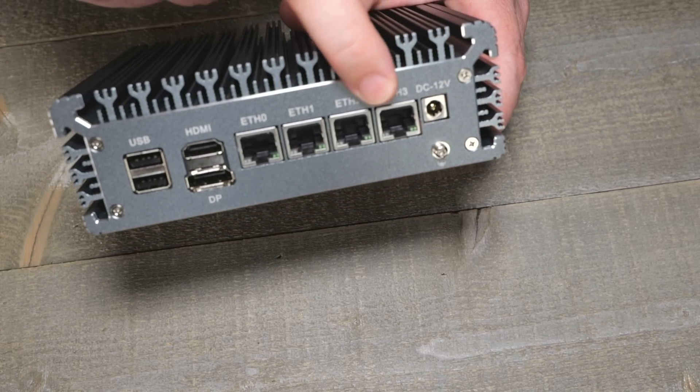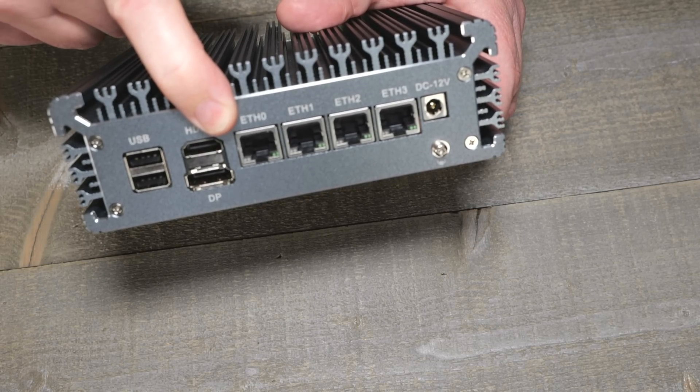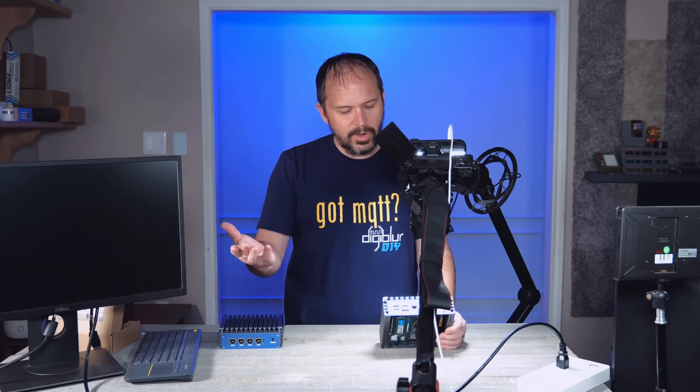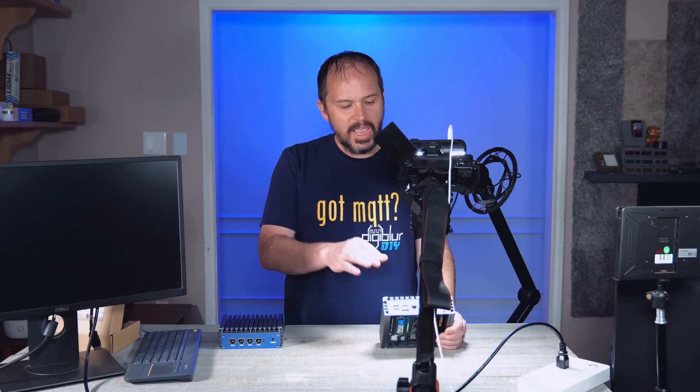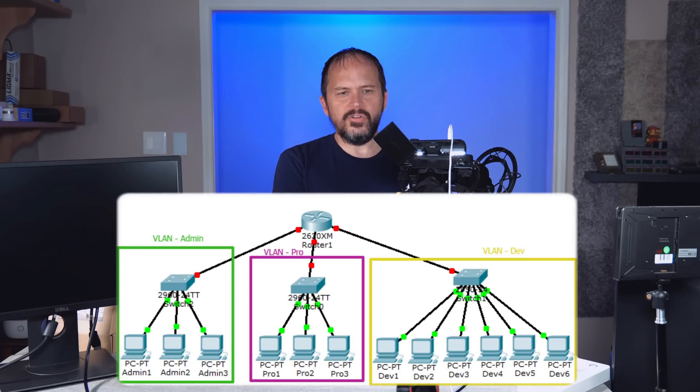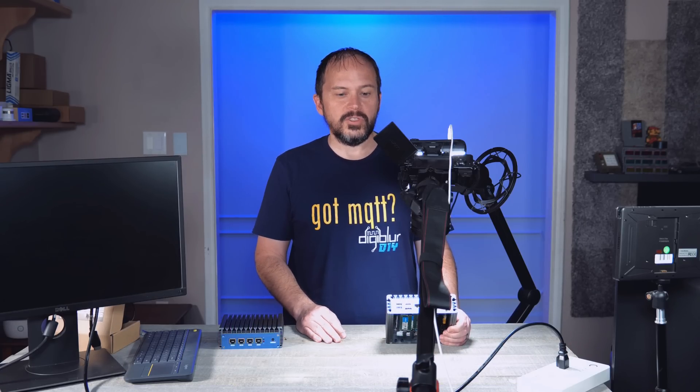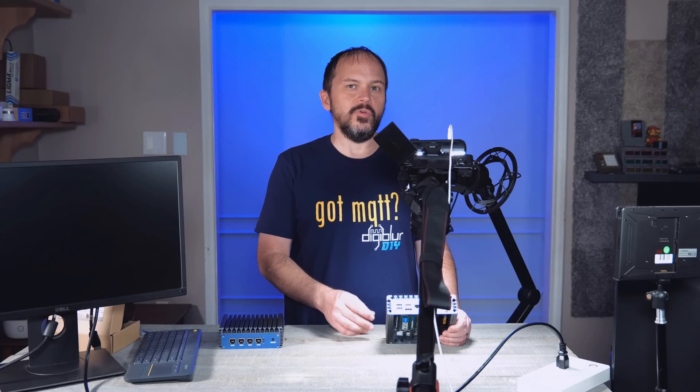On the front or back, there are four actual Ethernet ports — but it's not a switch. These are actually four Intel NICs, like four individual network cards. With the software you can join them together, but it's more for doing actual different LAN networks. If you want physical isolation without doing VLANs, you can isolate your cameras off to a whole different PoE switch, blocking them from the internet since they should be all local.